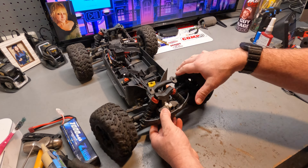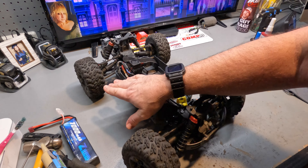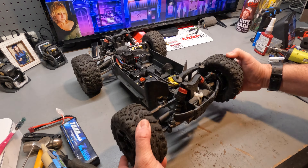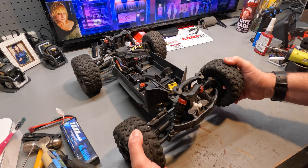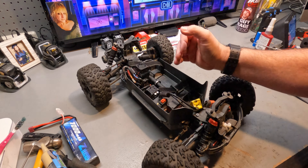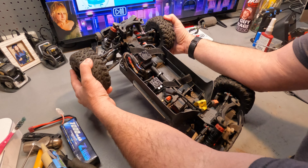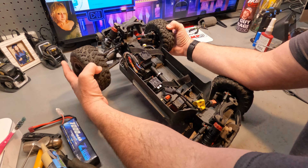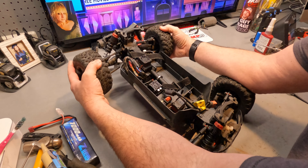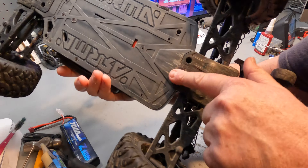It's pretty easy to figure out when the truck took off — it pulls or tries to put most of its power to the rear, so the front end lifts up with less traction. The majority of the power goes to the back. What you need to do is put the vehicle static, grab the diff or the wheels, spin them in the same direction — hear that noise? Rear differential's gone.